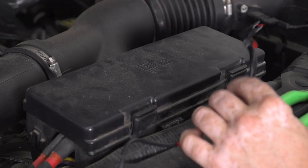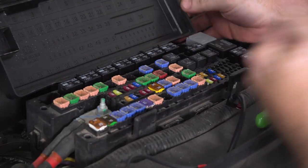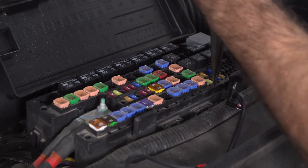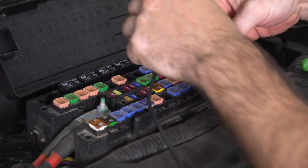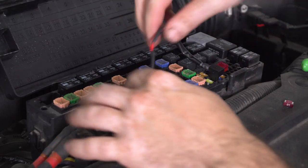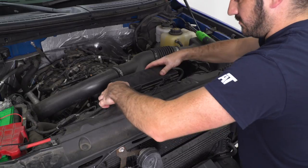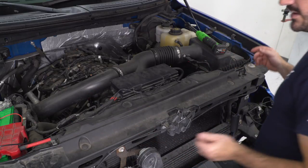This kit provides you with a fuse tap wire harness that needs to be installed into your fuse box. Locate the fuse box at the front of the engine bay at the very top and open it up. We're going to be removing fuse number 77, which is a 10-amp fuse — use needle-nose pliers to pull that out. Once pulled, install the provided fuse tap into place, then run this wire harness to each side for the headlights. You can then close up your fuse box.